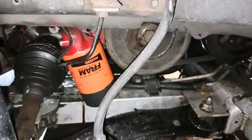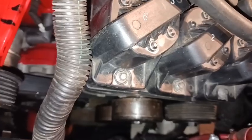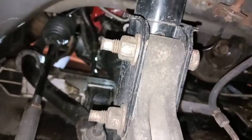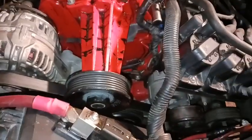It's 10 o'clock. I just drained the oil, swapped the filter, and Garrett filled it back up. I've got the main belt on. The brand new supercharger belt is too long — I don't know why — so all the other supercharger belts are at storage, meaning we'll have to wait until tomorrow for that. Just about ready to start — I still need to plug in the speed sensor, oil pressure sensor, knock sensor, and rear O2 sensor, then bolt the wheel back on. The battery's already hooked up and the fuse box is all plugged in.